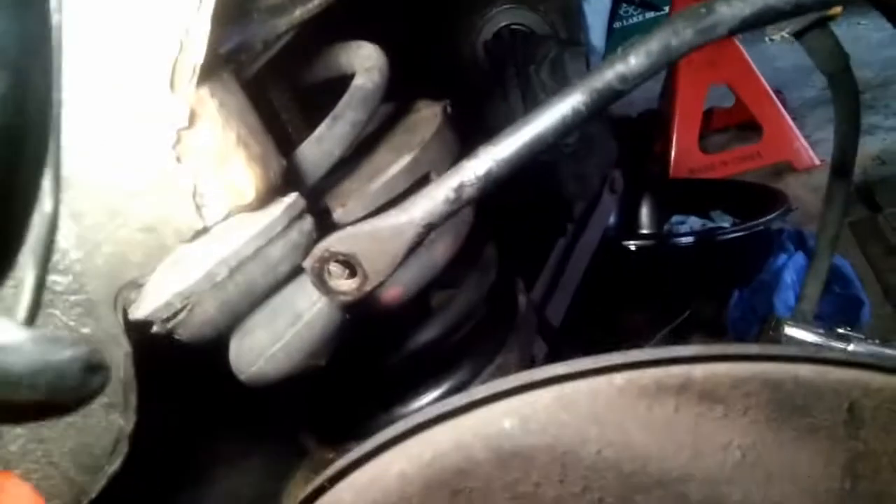It's getting dark. I thought I was gonna be able to remove the spring without the compressor, but it looks like it's not possible. Right now I have the compressor installed. I did remove the shock before removing — I had to remove the seats. My sway bar link is removed. Right now I'm undoing that spring. It's almost out of the way. But I had to compress it pretty much a lot.